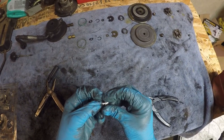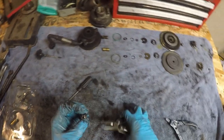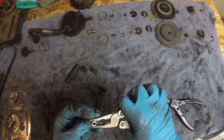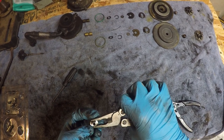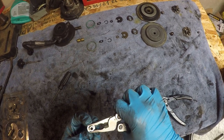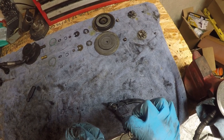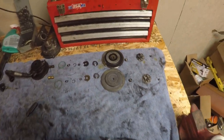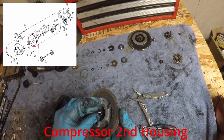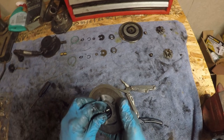It's a good thing that the rebuild kit came with the spare thrust collar retaining ring — so on that goes. It just needs a little bit of smushing; it didn't go quite so easily into the compressor housing. You just take the compressor housing and drop it into the back — there's only one way it really goes. Push until you hear a little click.